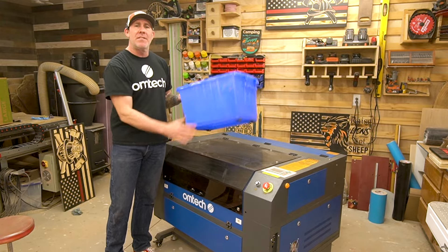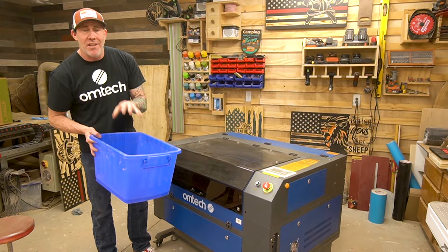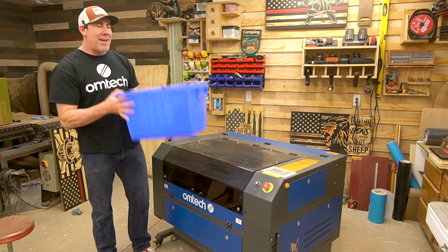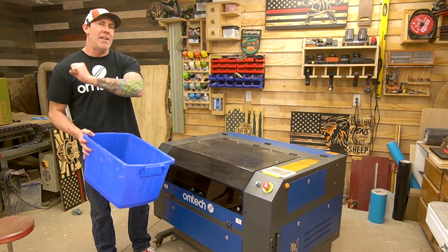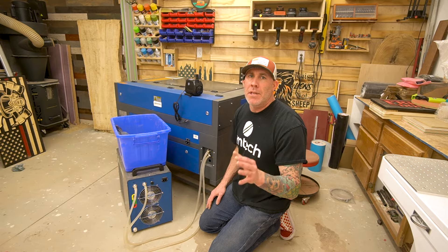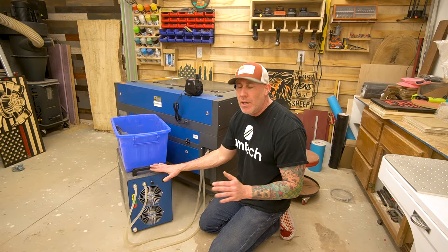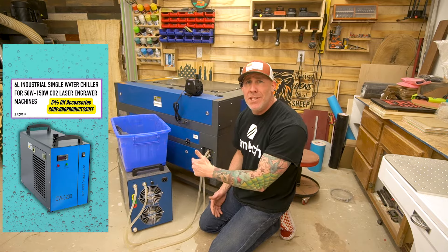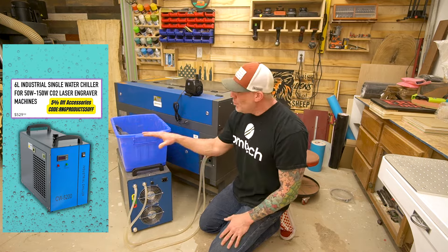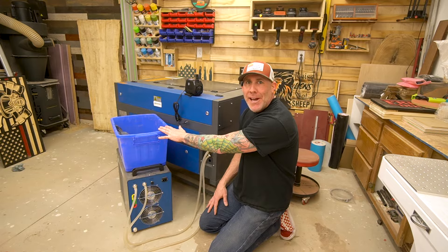Yes, there are going to be some cons to that, but that doesn't mean it should scare you. You can still buy this unit, have it delivered, unbox everything, hook it up, and have it running the same day. I would recommend prior to installation, run down to your local big box store or Amazon and pick up some half inch to three quarter inch hose clamps — that's the proper way to do it, as opposed to zip ties, which I've used in a pinch. Neither one of mine leaked, but that's pretty ghetto rigged.